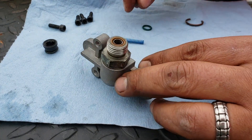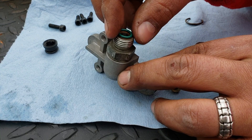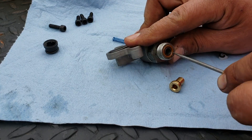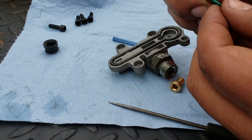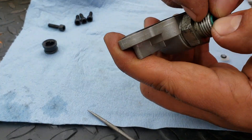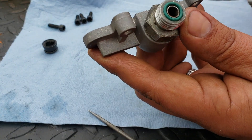I do think I'm going to replace this one with this. Inside the fuel filter there's a green gasket that looks kind of like this. I'm going to replace this one - hope I don't screw it up. It's almost an exact match, just a different color. Basically you just want to press it in - you don't want to roll it, you don't want to have a twist to it. Just press it down.